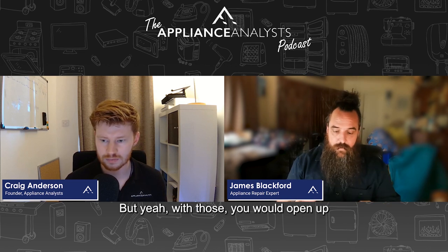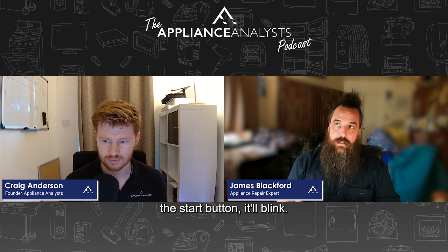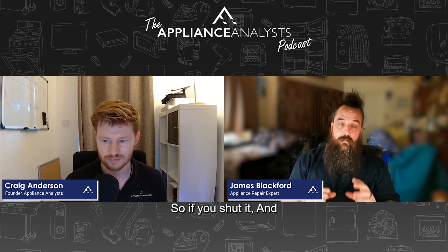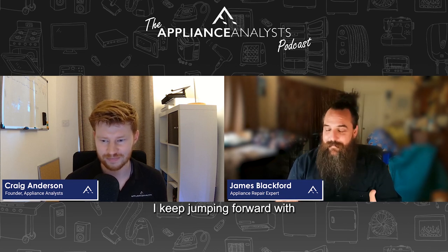With those, you would open up the door, select your cycle and options, hit the start button and shut it. Typically, once you hit the start button, it'll blink, and once the door's shut, it'll be solid. So if you shut it and it's still blinking, that's a pretty good indication that there may be an issue with the door latch. I keep jumping forward with the troubleshooting.